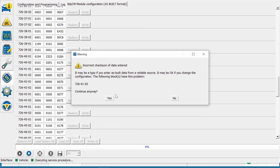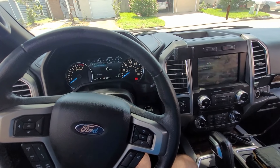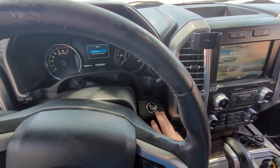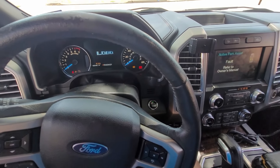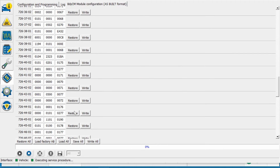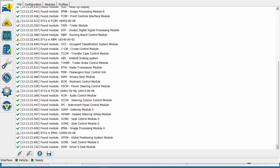Zero means disable — we're going to write that. It says as always this is incorrect, but proceed with caution. The thing turns off and back on — turn the truck off too, give it a second and turn it back on. Everything programmed okay, we're going to stop and going back to the beginning and disconnecting.